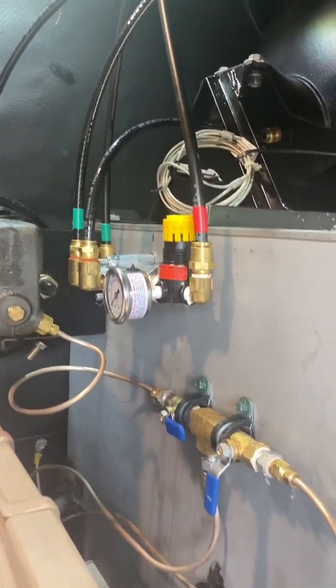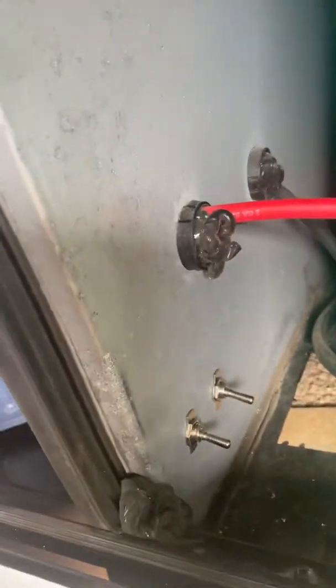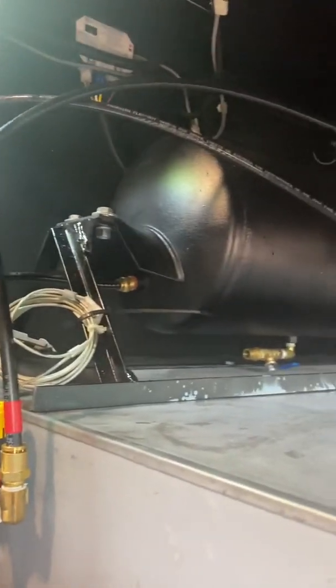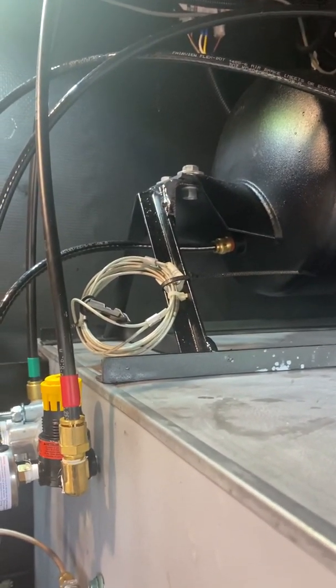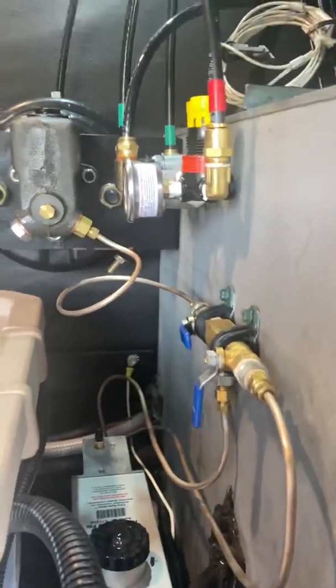Let me back off here so I'll get a little wider view. There's the master cylinder I attached on the side of the box, with my valve block for the electric setup. I tapped into the wires for the electric setup — that's probably not totally kosher — but I put the switches in there. I do have a backing plate for the master cylinder to handle its weight. The coiled cable there is my breakaway cable for the electric system — I just pulled that off and zip tied it there so it wouldn't get lost. So that's where we are with this.